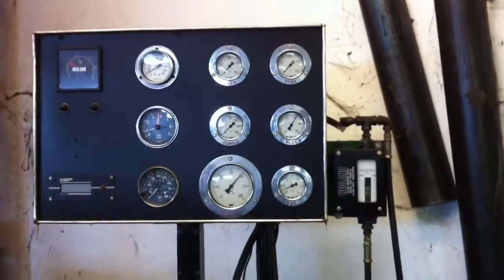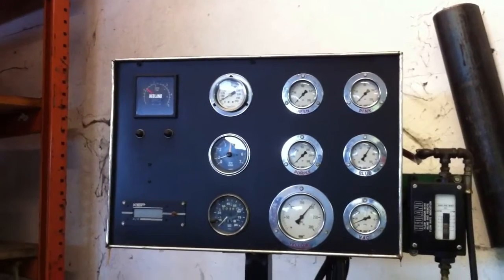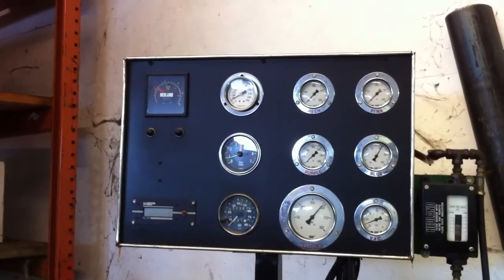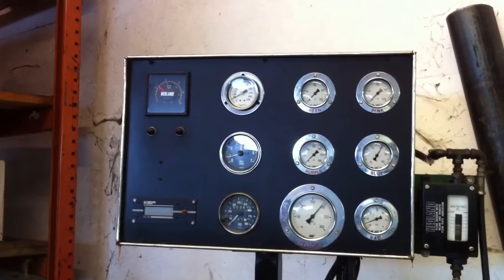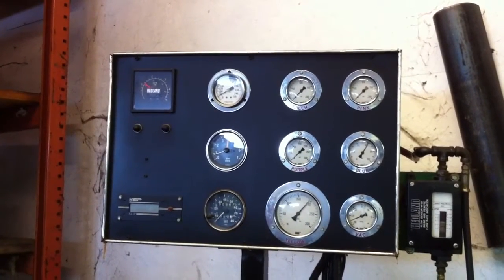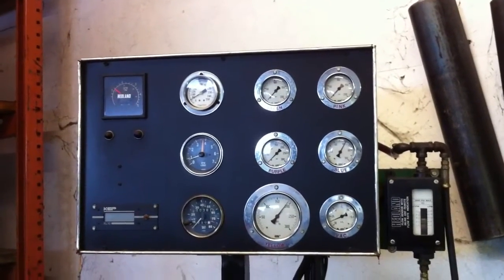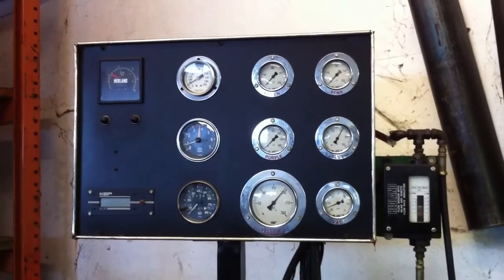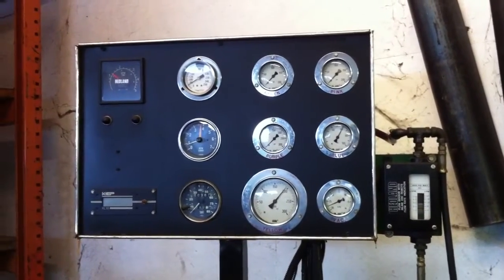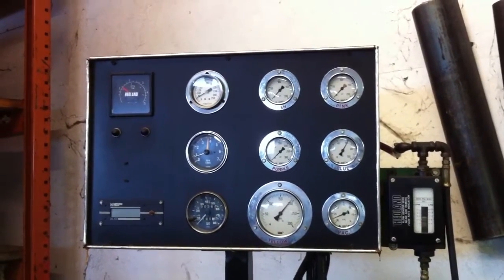Second gear went up to 200 on its own - so we're getting throttle boost. Now if I go ahead and max pressure, we're right at 200, not moving at all. Going to low - so now that we're in low range, give it pressure, it's at 200. So it's not changing. A little bit of fluctuation down.